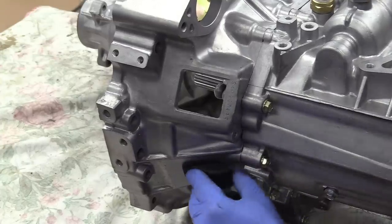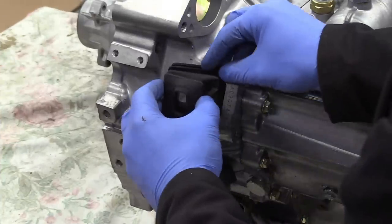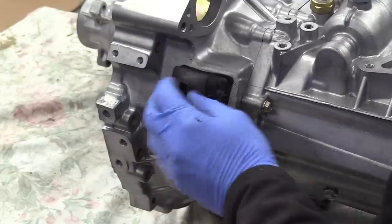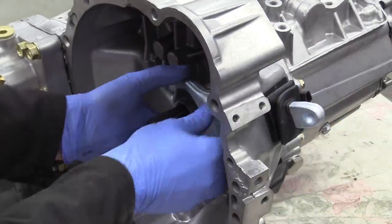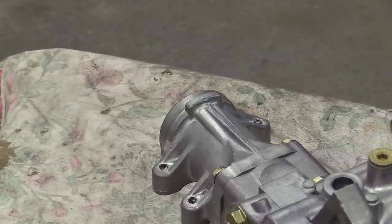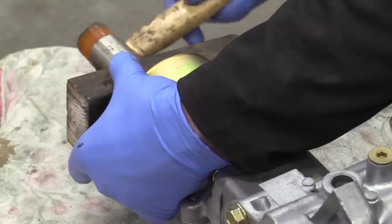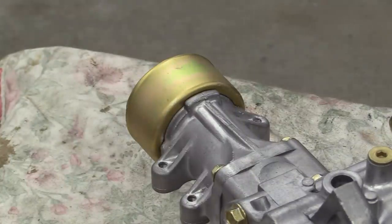A couple of cleaned up rubber bits next. First, a sort of air duct thing. Followed by the clutch fork gaiter. After smearing some grease on the pivot ball, the clutch fork gets installed. And I think the last piece for now, a bit of an embellishment. I love gold.